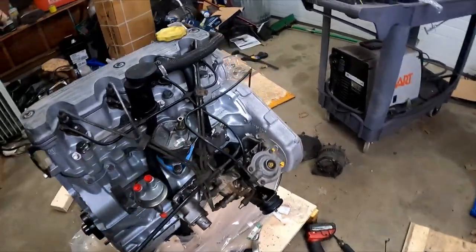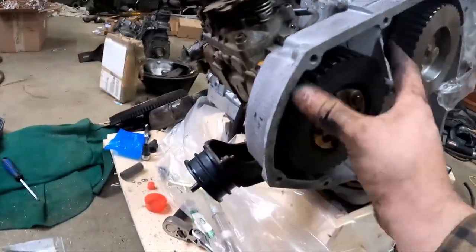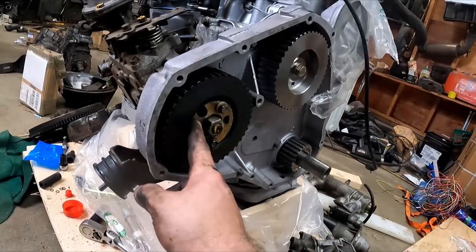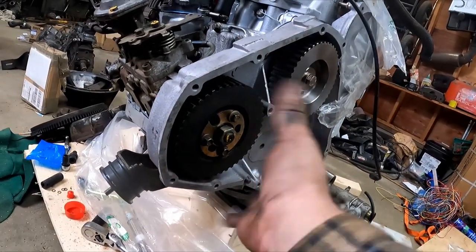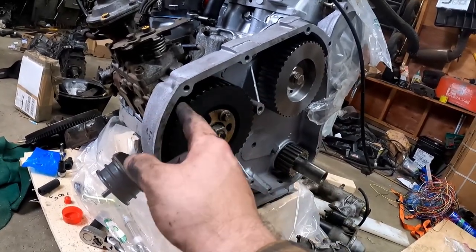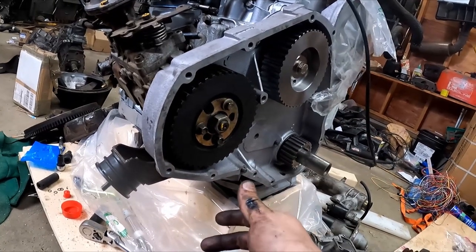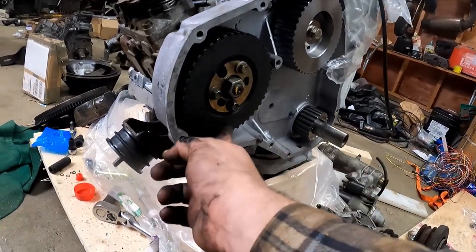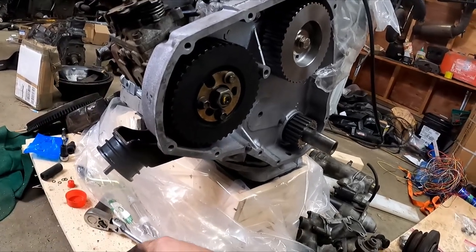This is on by — I never originally popped out the center, but this is an adjustable cam. By matching up the witness marks I should be good enough to get it started. We're going to have to go through and really properly time this because I'll never believe it's properly timed unless I'm the one that timed it. We'll figure it out together.